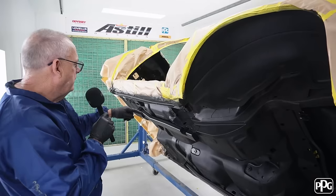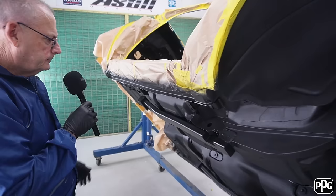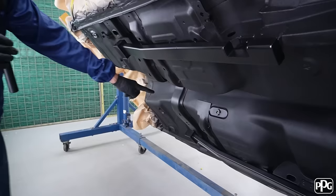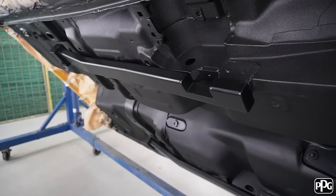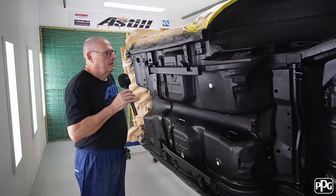Overnight I thought about this edge here — on any car I do I like to keep the front edge of the sill panel black. It'll be satin black because they always look untidy hanging down from the bottom of the sill. When I put the stone guard on I've highlighted things like the rails that have been added. Down here you can see the seatbelt mounts and the tank mounts at the back — just a bit of variation so not everything is done in stone guard. I'm happy the way it's coming along, and I'll get this clear on and then do the firewall and dash components.